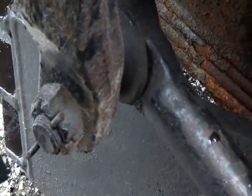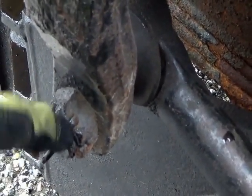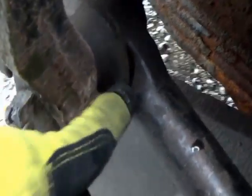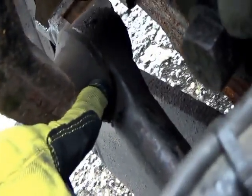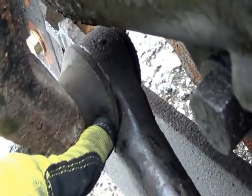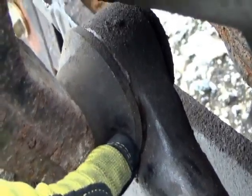They call it a castle nut because the nut has ridges so that they can catch the cotter pin, just in case the nut becomes loose. Inside, these parts are all metal, so you say not cracked, not broken, and secure. No illegal welds. And in between each part is a rubber bushing. So you want to mention that rubber bushing: not cracked, not broken, and secure, not dry rotted or frayed.